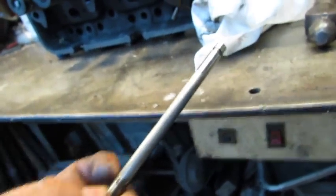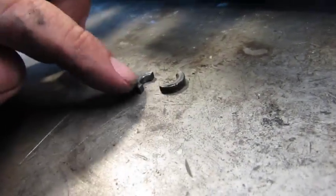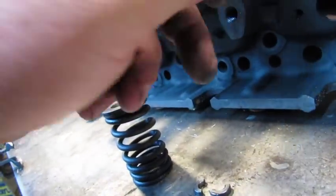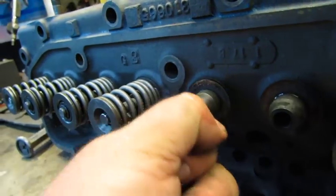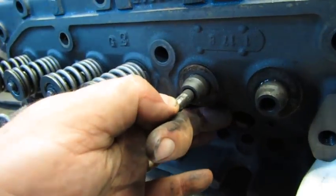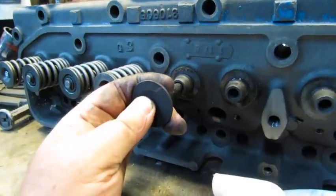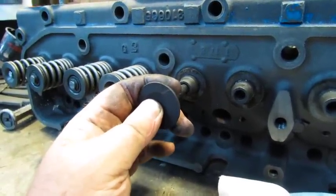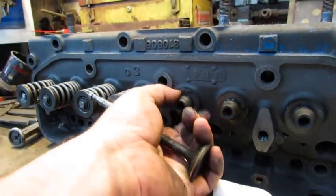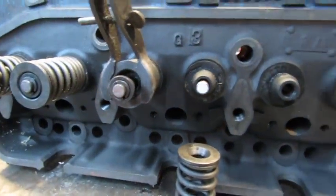Wonder if it's poor quality valve or just the guides were loose to start with. Look at them weird kind of keepers. These are new valves - say Brazil right there on them. See that - she rocks pretty good. That's okay, I got new guides. Somebody shimmed it up for high performance - some funny business on this old thing.